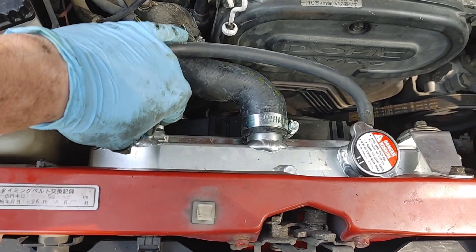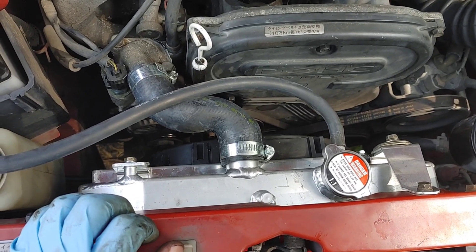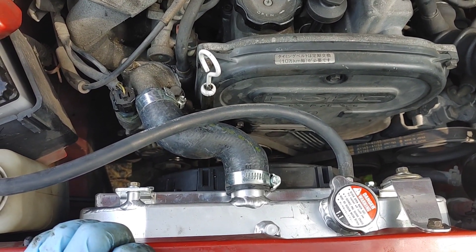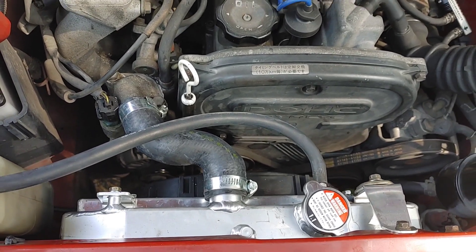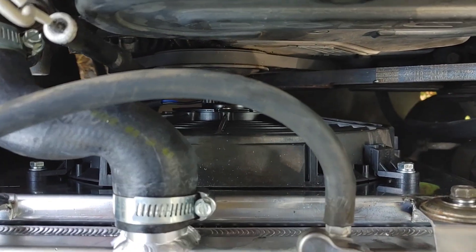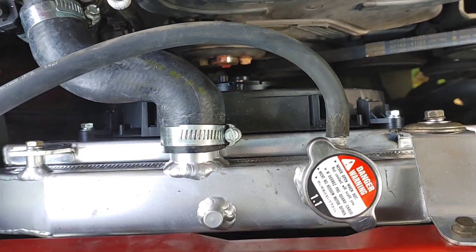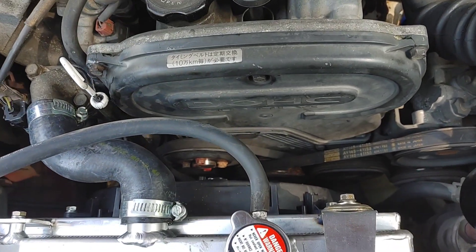There's a little bit of wiggle — with another mount right here it should be rock solid. The fan, for now, I'm probably just going to wire it to come on with a switch and the AC. I'm going to get a temperature probe switch, a fan controller. What's nice is, if you look, it's almost the exact same size and spacing, so if you wanted to keep your mechanical fan, you could. I'll see how much electrical draw this creates versus the mechanical loss of driving a clutch fan, and I may just swap back out for the clutch fan.